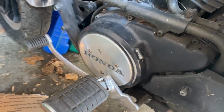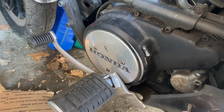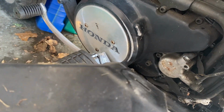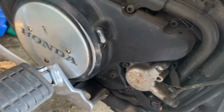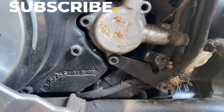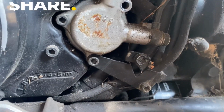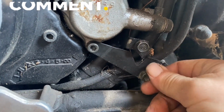Okay. What was that, a 5mm? It's the same as the other side. Yep, 5mm. And then our bolt comes off. There's our cover. I don't know if that was actually leaking or not. Okay, a little dirty down here. This silver guy, that's your slave cylinder. That's what we're after right now. Wonder if that was just whatever gas came out of there. That might just be what that moisture was.